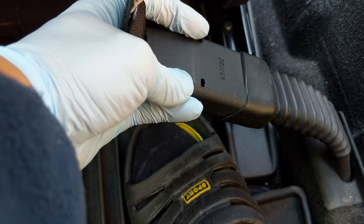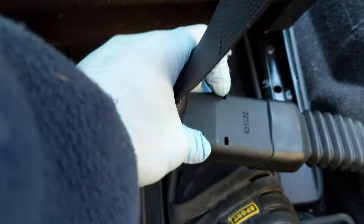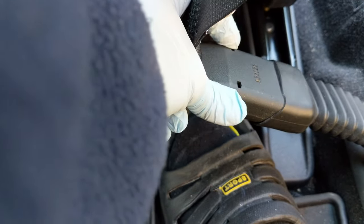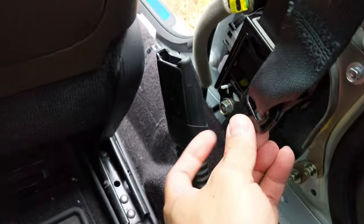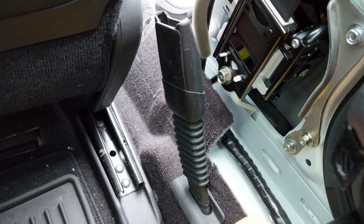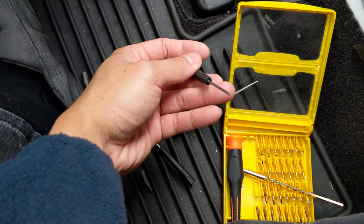On the lower part of the seatbelt, you'll see on this side there are two holes and one hole on the other side. You want to take some paper clips and depress towards the lateral side on the two-hole side, and push in on the single-hole side. Taking this belt off was by far the hardest part.